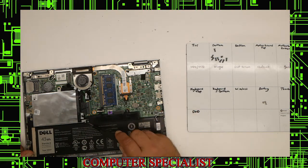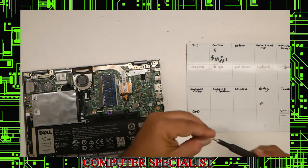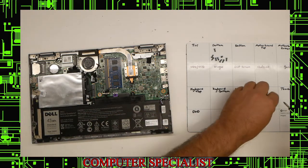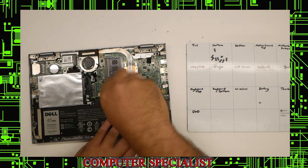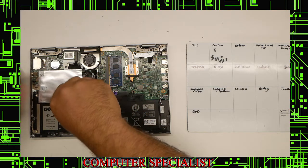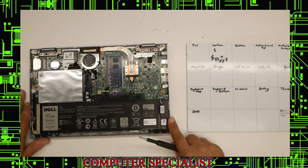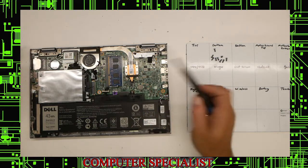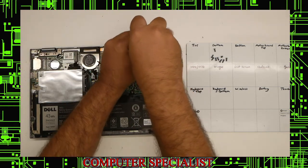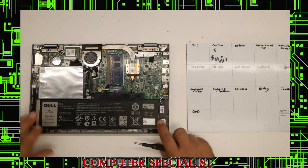So at this point we're going to put the hard drive screws in. The most important thing is to make sure this bracket is under the battery — that's very important, because if not, you've got problems. Once that's on, stick that back on there. Screw, arrow, screw, arrow, screw, arrow. Do not put a screw in there because the bottom case is going to run. One good thing about these magnetic setups is that as you're doing this, if you were to forget the hard drive screws, you'd notice the other screws that you haven't put in yet — they help remind you. There's been times I've gotten back and forgot to put that in.